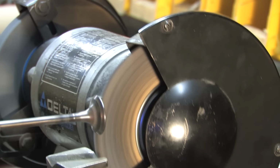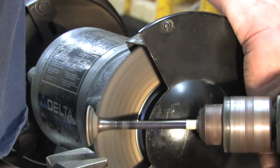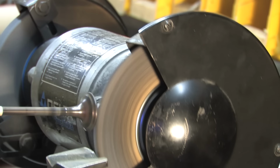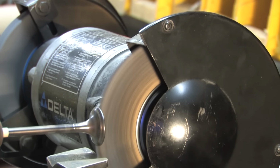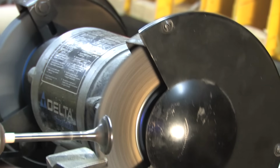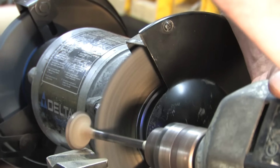The drill serves triple duty and then some. It gives you an easy means of safely holding the part while you're cleaning it. It prevents you from spending any length of time cleaning one spot. It cuts an immense amount of effort, or bleeding, that you'd likely go through with most anything else. You're not going to have a valve go flying across the room or mark it up with hand tools while holding it.